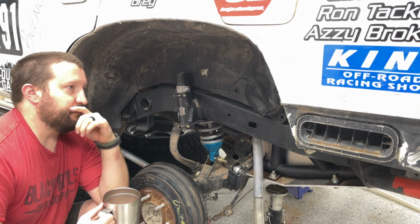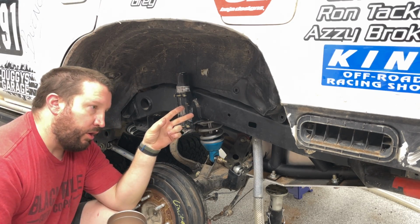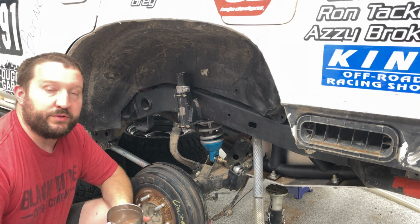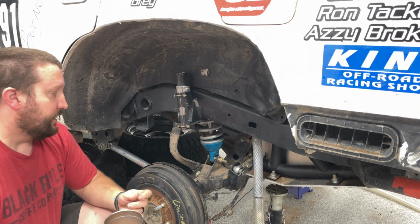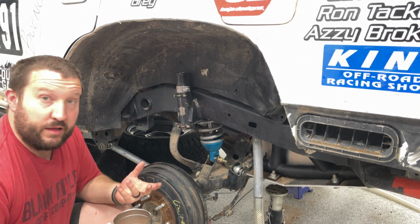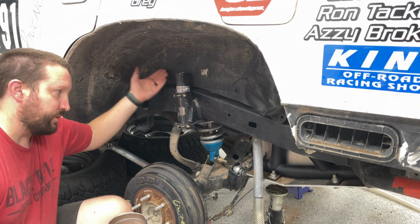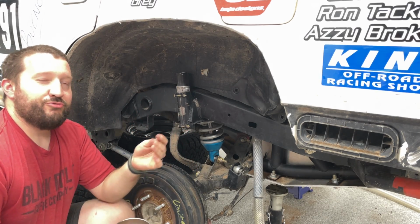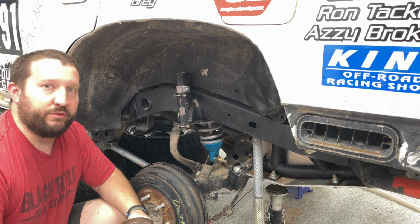There's a big question about that though. If the axle is going back and if the axle is getting wider, are the shocks now in a good spot? I mean, they're up, they're well protected, but they're not really in a good spot. Anytime that the suspension is on top of the axle, it's kind of unstable. If you can go outboard and down, now it gets a lot more stable. If the axle's going this way and the coilovers are coming out and the track width is coming out, why should the coilovers be attached to the axle at all? Couldn't they be attached to another arm?